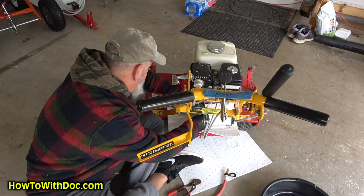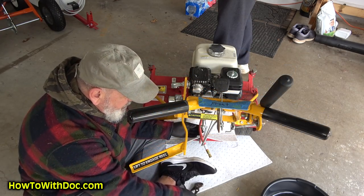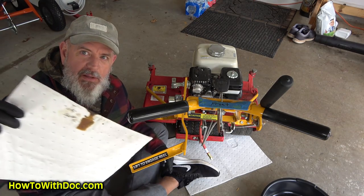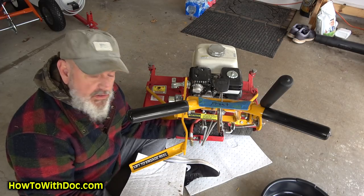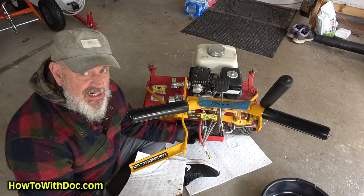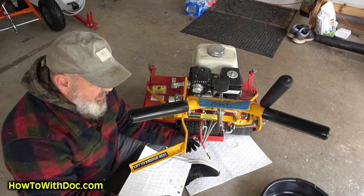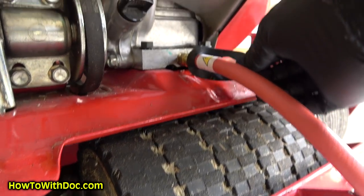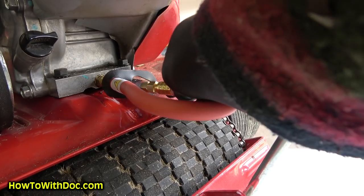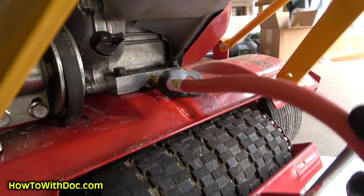I can feel that it's loose and there's a tiny bit of oil coming out. Now I'm going to tighten this — about that much spillage, it's not bad. Now you can see I have this long tube sitting here which I can put into an oil drain pan and save myself a lot of trouble for future oil changes. So now we're actually going to start this engine up, let it run, let it warm up for about five minutes, let the oil get warm, and then we'll drain it. Ryan was asking about the black thing here — so this thing can hook around here and stick in there so it's out of your way. When you want to change your oil, you can pull this out and drain it.